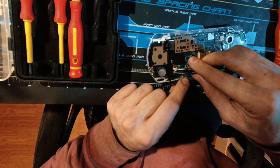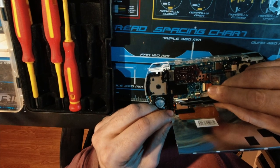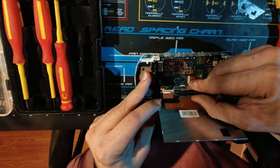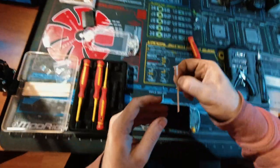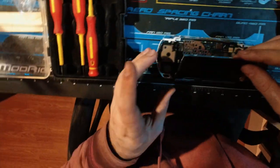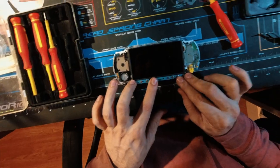Get the display. Make sure that backlight cable is in, make sure that display cable is in. Now this little metal bracket has to go in — this goes into this corner right here so that way the display can come down and then it latches into it and holds it all nice and straight. That clips in.